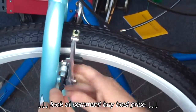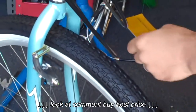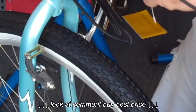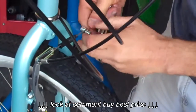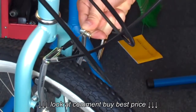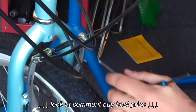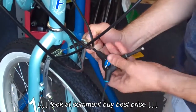Put the quick release in while the cable is still loose and route it through the other lever. Cinch it up nice and tight and then back off a little bit from that. Use your 5mm Allen wrench — that's all you need for all these parts. Check with the hand lever whether that's the tension you want. If it wants to be a little bit closer, pull it in and make it a little tighter.